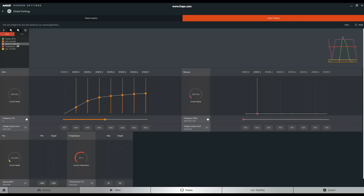Then you will have your visual play area. Here at the top you've got the GPU monitor. Then going down you have the clock and memory settings, and at the bottom you can adjust the temperature and the fan. Actually guys, before you do anything you should run a benchmark and figure out what your baseline score will be.